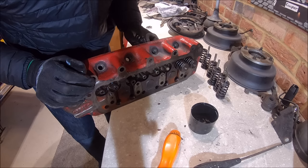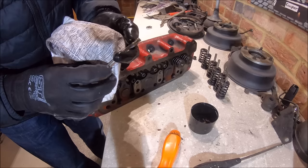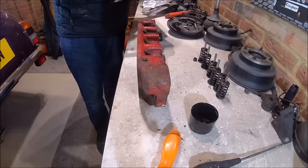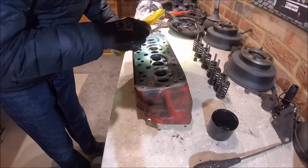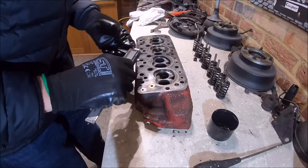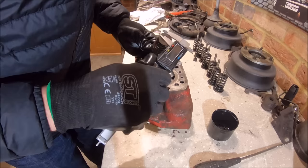One valve is picking up right on the end — it might just need a closer look. It gets stuck there, so whether it's slightly bent or there's a bit of burring on the end, it shouldn't do that. I'm a little disappointed — not quite sure what the issue is at this stage, but it certainly means it won't be a straightforward skim and refresh. It's looking like there'll be more work involved. This valve has a problem and we need to work out what caused it to make sure we don't build the issue back into the engine.